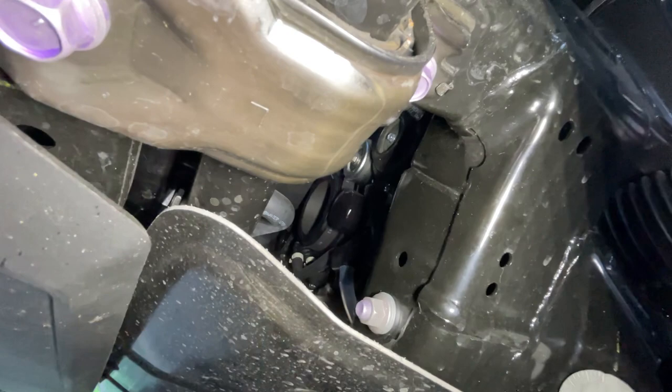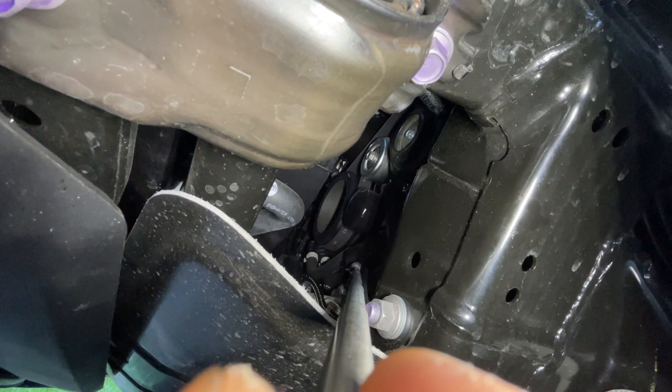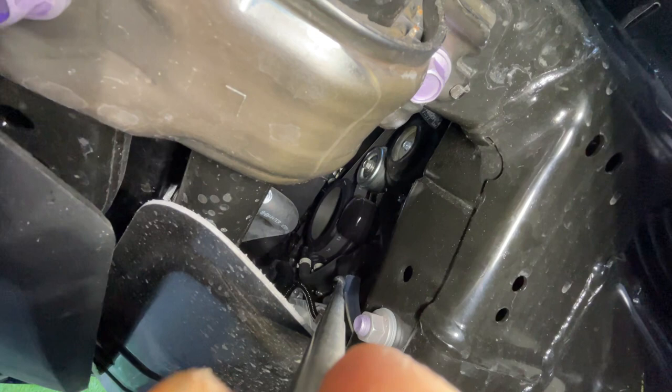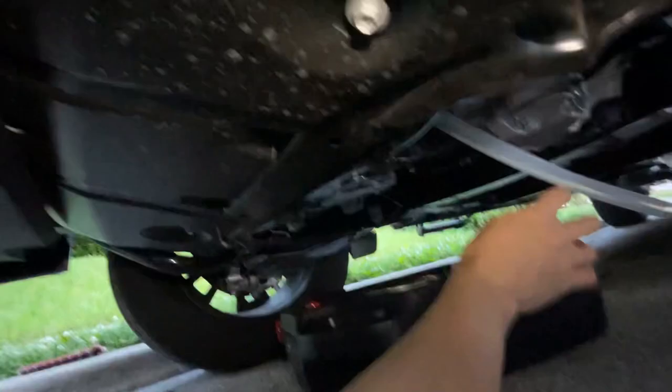You see your oil filter in there — that's what we're going to be taking off. You will also see underneath it a bit of plastic tubing. I put it up through this gap here and connected it to this little catch which is directly underneath your oil filter. That's designed to catch the spillover when you remove your filter. If you attach that 15-millimeter interior diameter plastic tubing, it's going to catch all the mess you would otherwise create. Make sure you run it down to your drain pan before you do this next step.